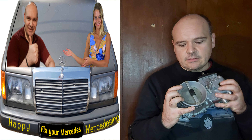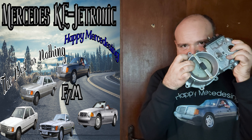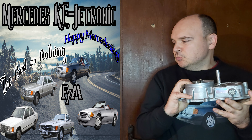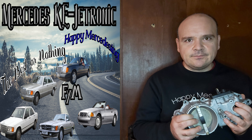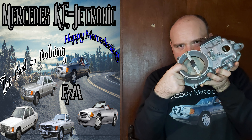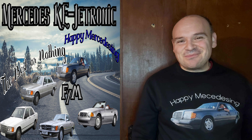So as you see, what has to happen when you start the car — the sensor plate has to deflect, it has to go downwards. Once it does, it moves the plunger — the central piston — in the fuel distributor. And once air and fuel are sucked into the cylinders, that's where the magic happens.